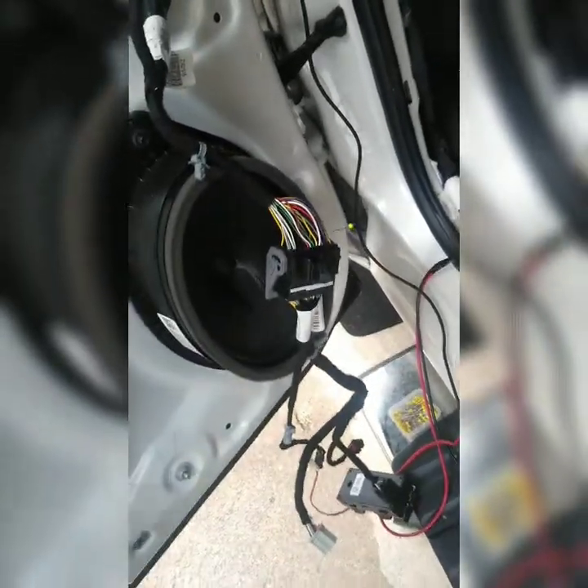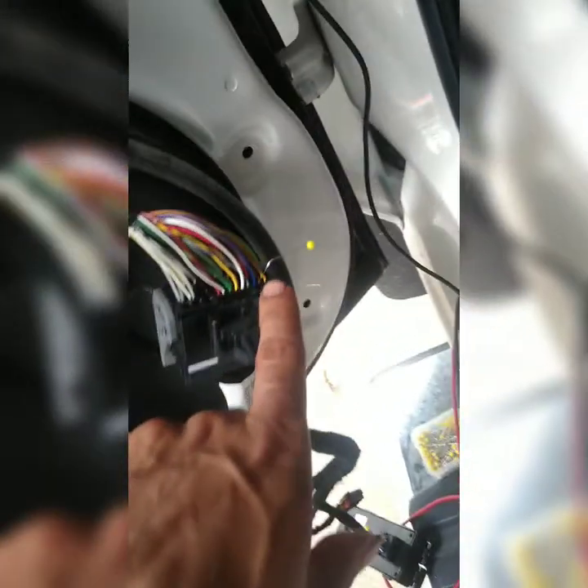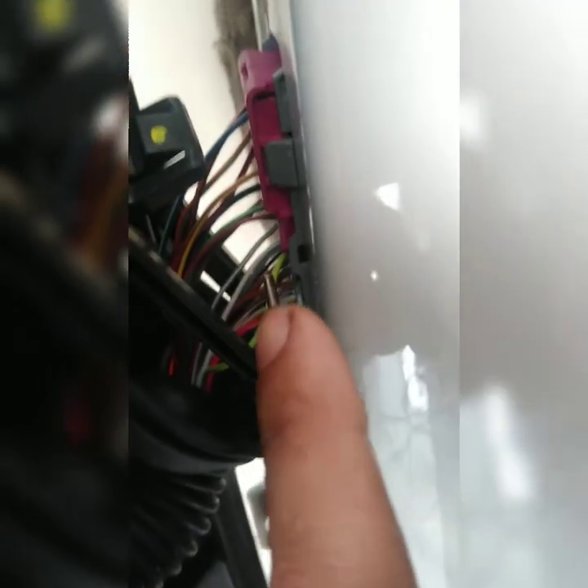What I basically did was trace that wire, because I know that on these cars — in general, all cars — they start breaking their wiring right on this boot here. I stuck a pin right there and pinched it with my alligator clip.